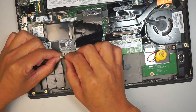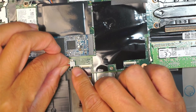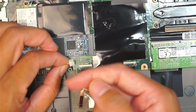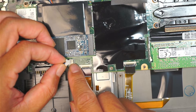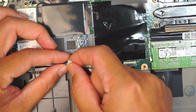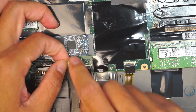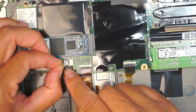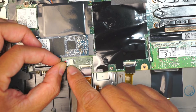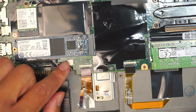To connect the battery, you want to pay attention to this. On this side, you're going to see that the speaker connector has a metal — like a silver-plated metal — pointing up. And then on the other side, the connector is flat and has nothing on it. So to install it, if you remember when you pulled and disconnected the connector, the dot is supposed to be facing up toward the sky, and that metal plate that you can see — those metal dots — are supposed to be facing down toward the ground. Do not flip it the wrong way, because as you install it, you might bend the pin on the connector. So make sure you're facing the right side and install it.